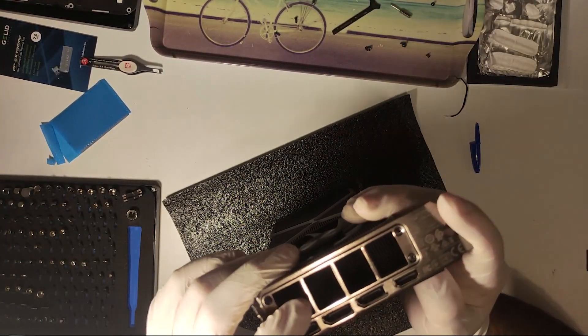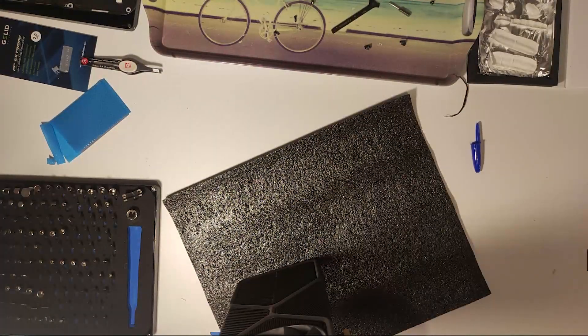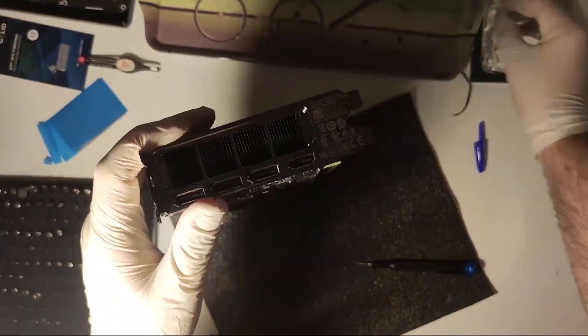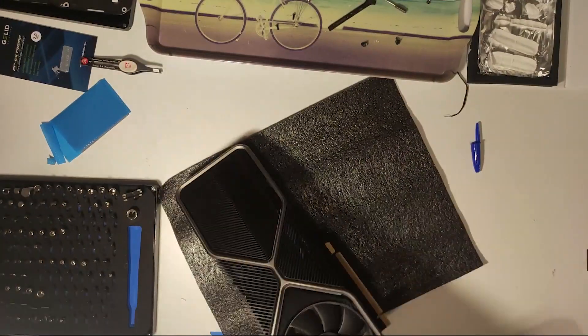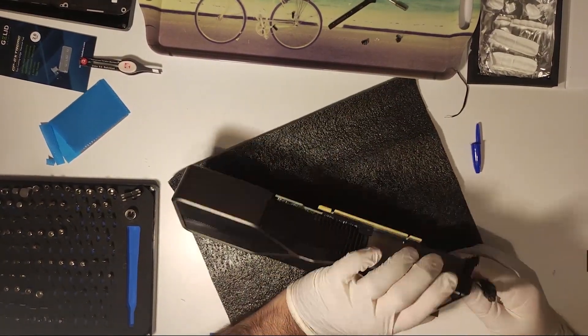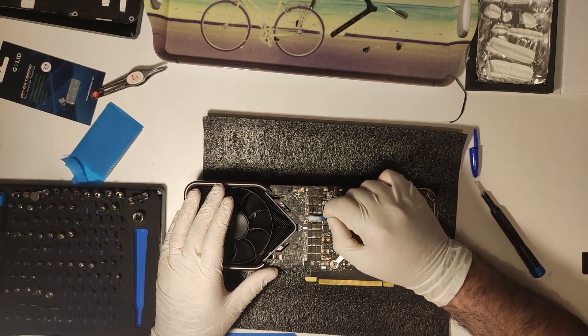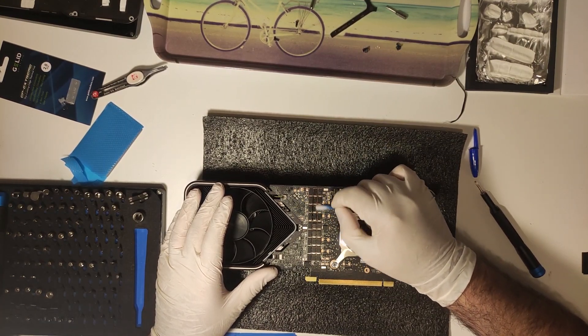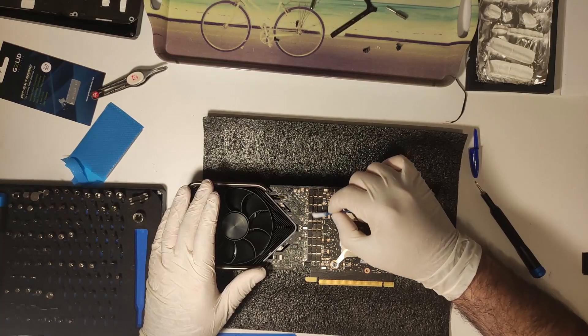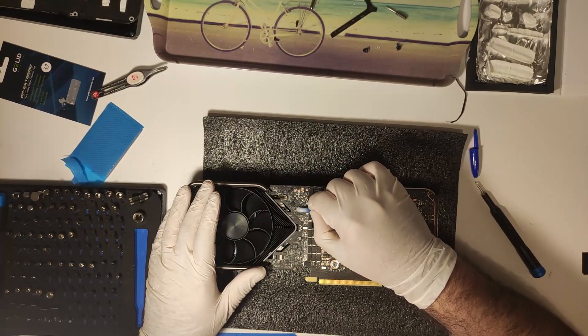Reattach the bracket, then take a break — if it's your first time doing this procedure it's probably been about an hour and a half. After that well-deserved break it's time to test the card. The backplate's importance for memory cooling is minimal — the main objective is good contact between the cooler and PCB components. Having the backplate on will definitely help but not by more than 2 to 3 degrees Celsius, so testing the card without it at this point is essential.